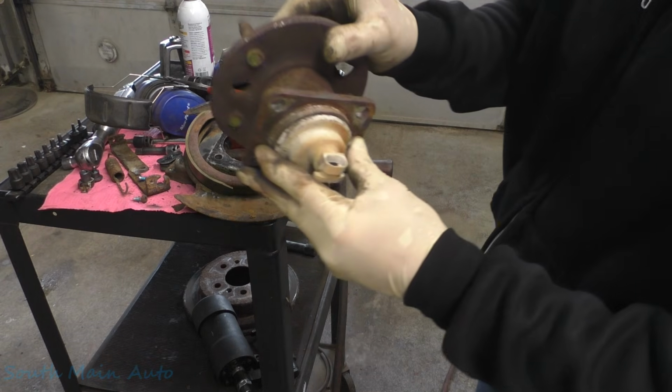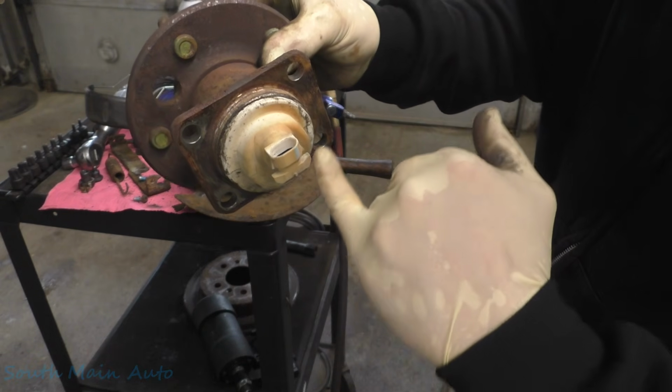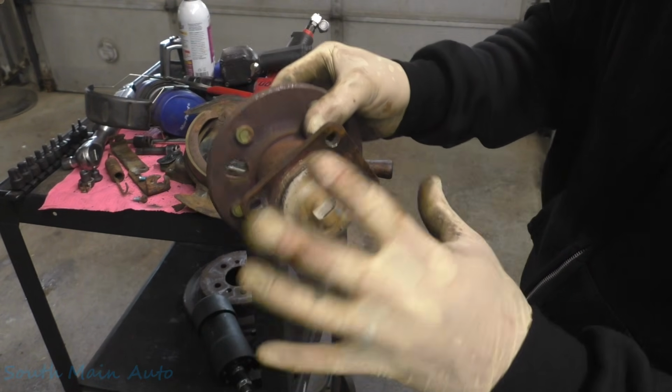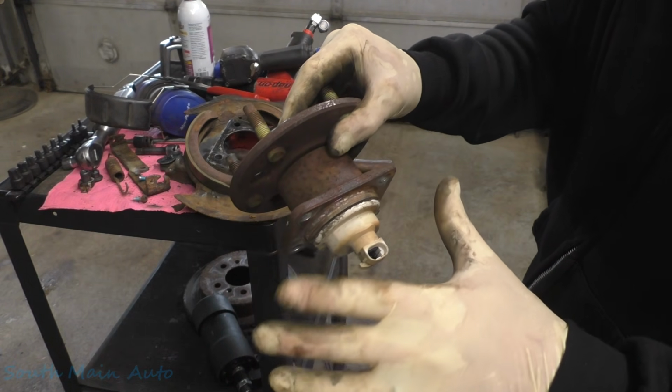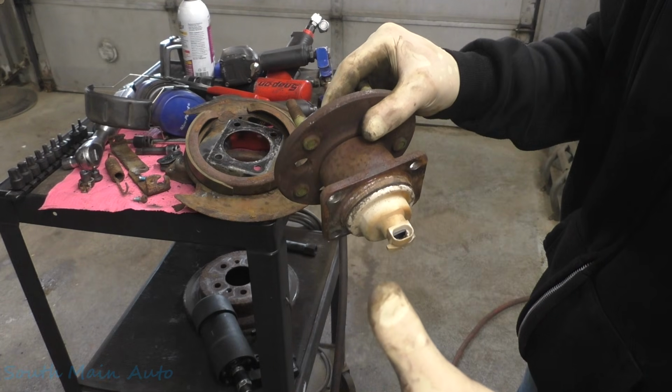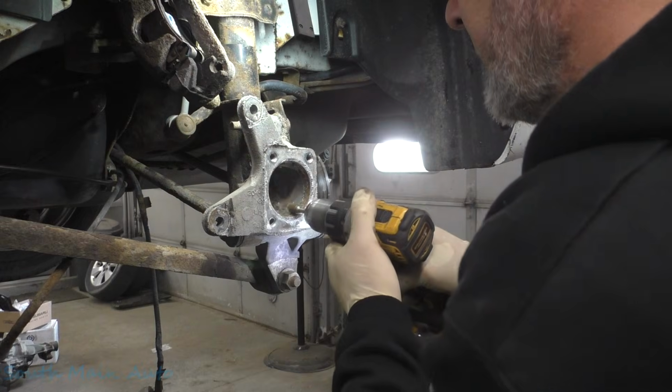And the reason we're changing that is because there's so much corrosion up inside the pins. I'm afraid it's migrated down inside the speed sensor because he's having an issue with this wheel. Tried to clean the corrosion off, and it works a little bit. Light still comes on, goes off. So we're just fixing the problem this time.